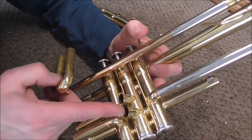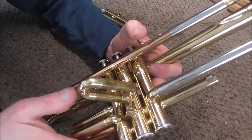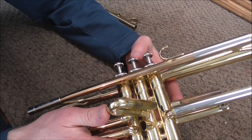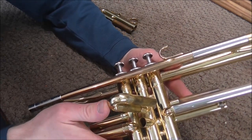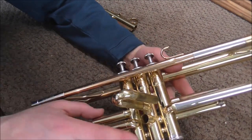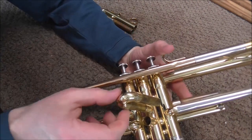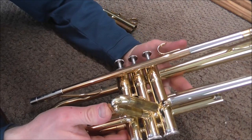If you think one or the other is bad — and likely it's not both — just put it into one of them and push with a little bit of force, not too much, and then see if the valve works better. If you can get the valve to work under pressure by pushing just a little bit farther, then when you let go, if the valve works, it's fixed. Sometimes both might be bent, just by different amounts, so you'd have to do it twice — try it once until the valve works a little better, then try the other one until the valve works like it's supposed to.